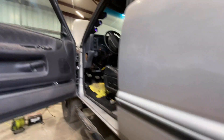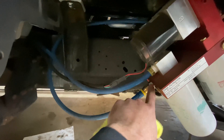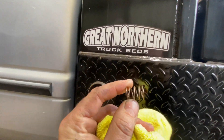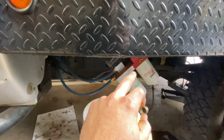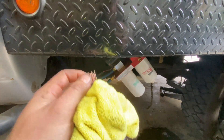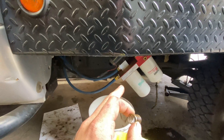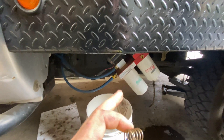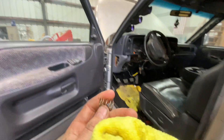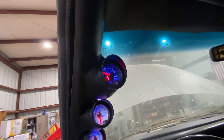I forgot to film it, but this is the return to the tank. You take the hose off that fitting, and then behind the fitting that goes into the housing there is a spring. This spring is supposed to be a 55 spring, but in it is a stock spring — for a VP44, so it was like 15-18 PSI, like a stock FASS pressure. For the P-Pump I needed a little bit more, so I stretched that spring and got it up to 25 PSI with the P-Pump swap 24-valve. That wasn't high enough, so I got this little adjustable — it was like 20 bucks. I put the stock one in that I had stretched, and now it's at about 45 PSI, which is ideal — I kind of like it right there.